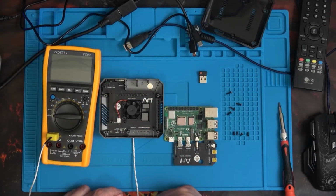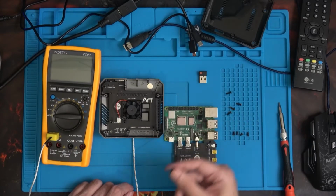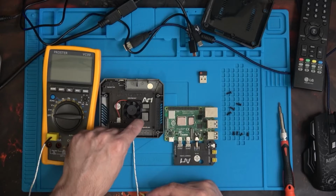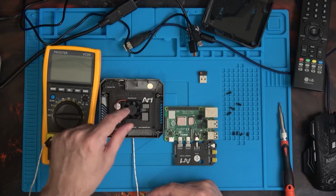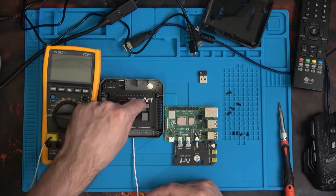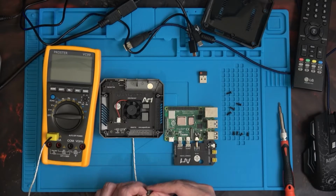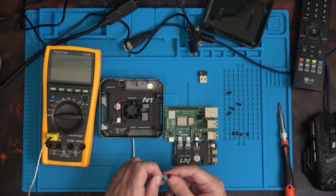Okay, so I've done the thermal pads and closed it all down and forgot I was supposed to put the heat sinks back on. So what I'll explain is that when you're cutting for this, if you line it up to the edges, you'll end up with a piece that's sort of sticking out, and that happens to be the correct size for the GPU bit.